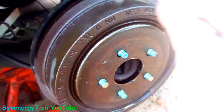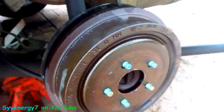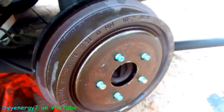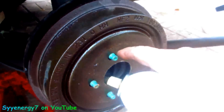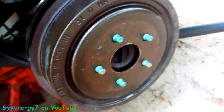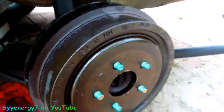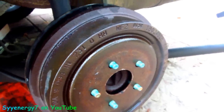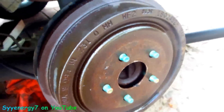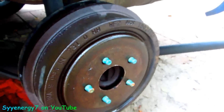So like I said, I rotated the wheel, turned it around so when I was spraying the PB Blaster, instead of it pouring down one way the bottom part was up so it was pouring down the other way. I had the three screwdrivers around just like a hub puller, pulling it away - which is a lot of power on here. I kept tapping the screwdrivers in and kept tapping all around in here, not too hard - all of a sudden it popped. That's it.